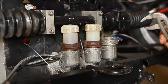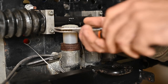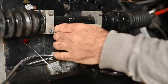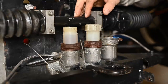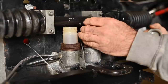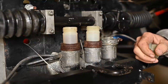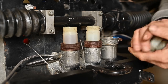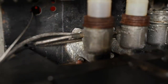That seems to be locked, so we're going to use some pliers to open that up — not something I really like to do, but sometimes we don't have a lot of choice. I can still see braking fluid inside, but this one is very low. I'm afraid that everything is corroded. You can actually see that we have rust on the lid, and also white deposits on the body itself, which is not really good either.